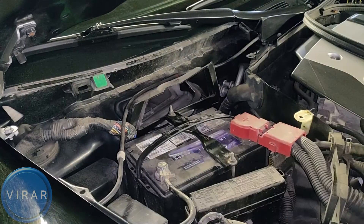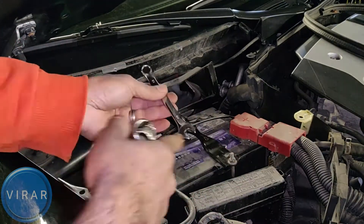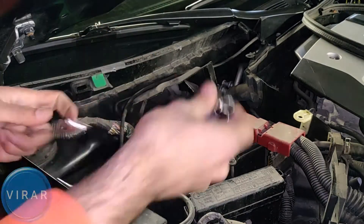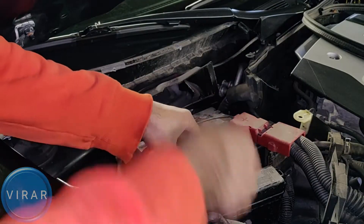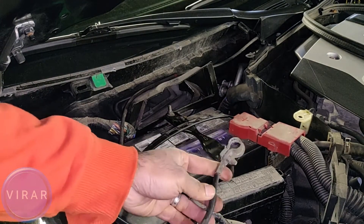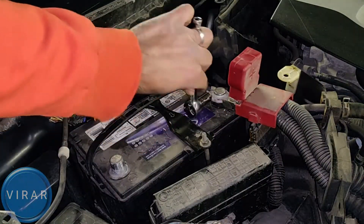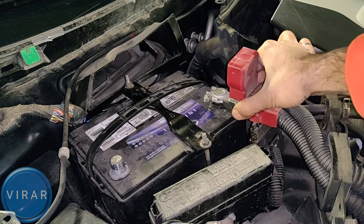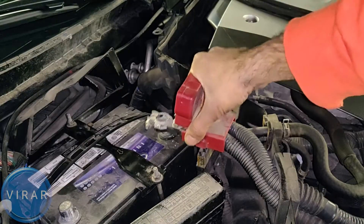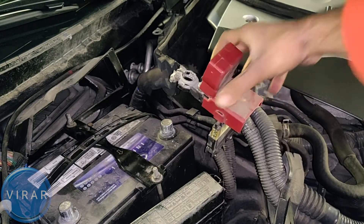Once the black panel is off, there are four bolts in total that you need to take off — they're all 10mm. You can either use a wrench or a socket ratchet combination. First off, go ahead and take off the black wire, the negative terminal. Once that is off, take off the red terminal — that's the positive one. Loosen it and take it off. With the positive one, once you get it off, try to support it with that white connector tab so the whole positive connector is out of the way.